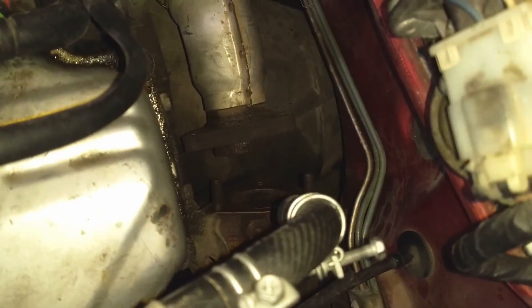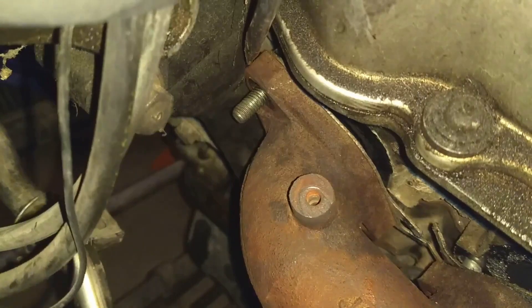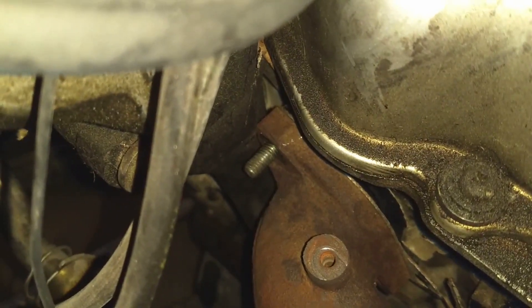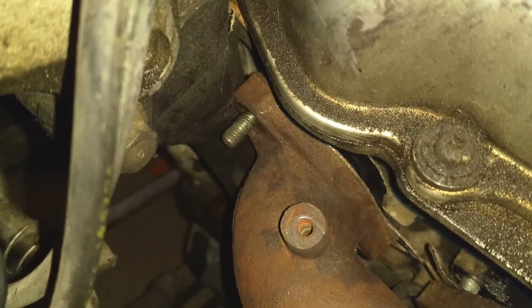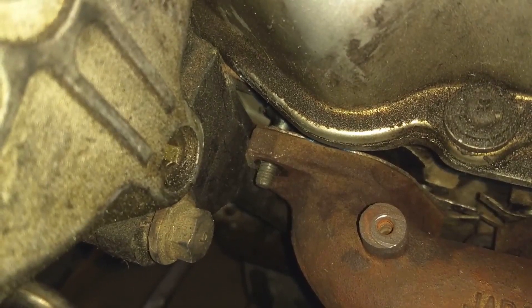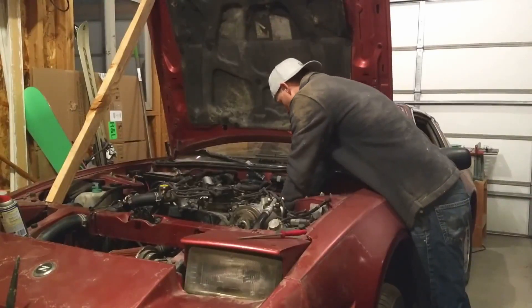I got it loosened up — you can see it's off there. It is off down below and this thing should come off, but I've run into a snag right there. The very edge of the exhaust manifold is just caught behind this metal recess right here and I just can't get it out from behind there. I think what I'm going to have to do is get out a grinder and grind just a hair off of that to get it out. If that doesn't work I may have to file it. After filing that metal piece down a little bit, I was able to pry the edge of this exhaust manifold around that. Now this whole thing should come off without too much trouble — let me give this another shot at just getting this thing out of here.